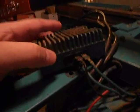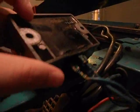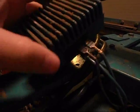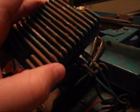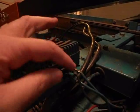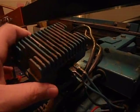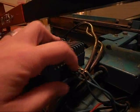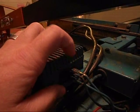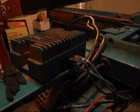Here's my voltage rectifier. The source of my confusion is that I have three wires here, and they're each connected to their own separate connector. They don't appear to be tied together in any way, and I'm really not understanding which wires need to be pulled off and connected together. I would assume it would be these two, except from looking at the schematic it looks like there are two opposite legs of AC electricity on each one, and you just don't connect those together.